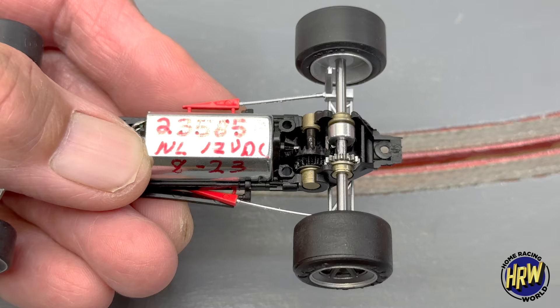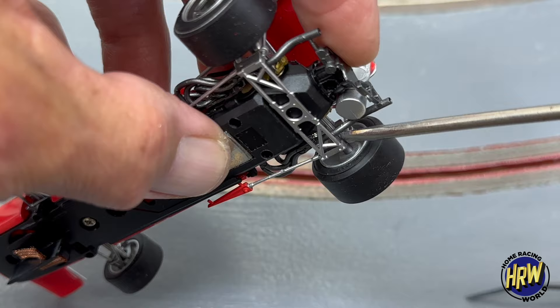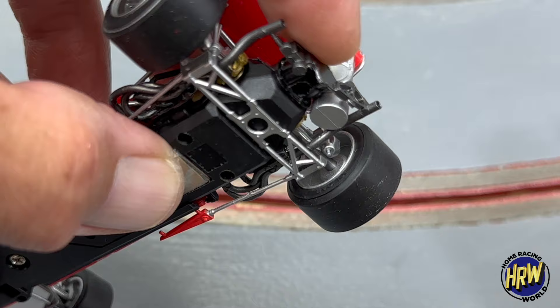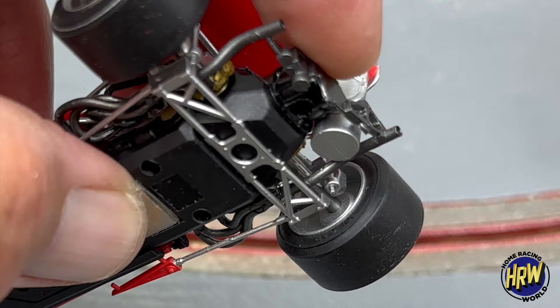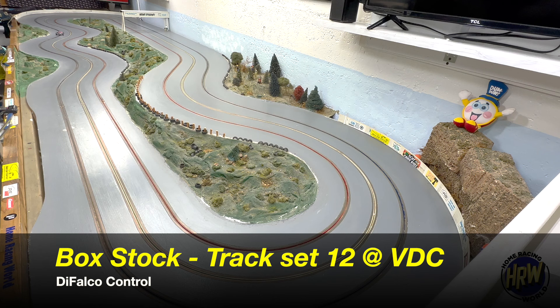Hopefully you can see this a little clearer — this is where the exhaust meets, right there, almost directly underneath the axle. You want to make sure that is installed 100 percent on each side, so a tweezers really comes in handy to align those pipes. Just make sure they're both lined up and installed properly, and then you can reinstall the screw. Just a super smooth car.